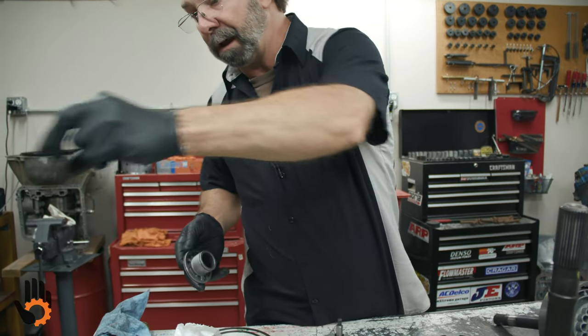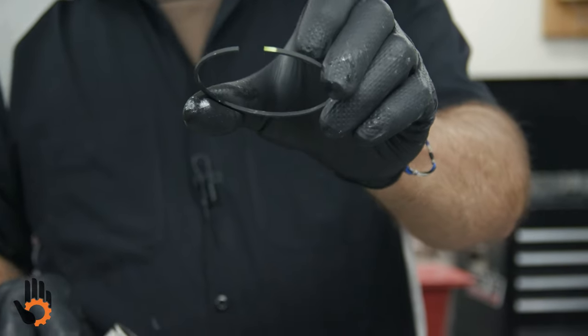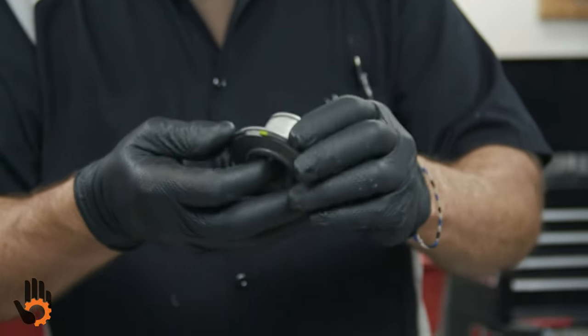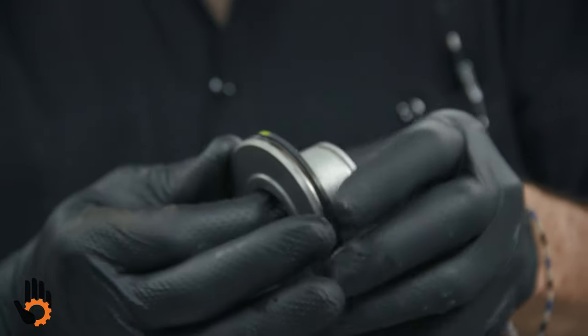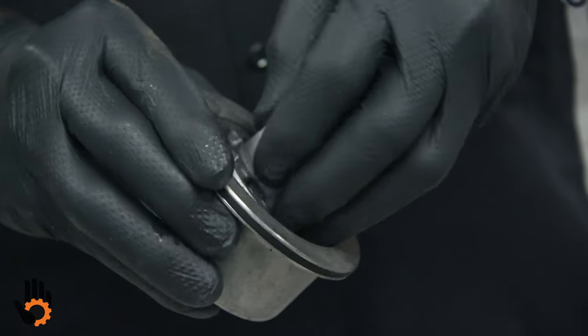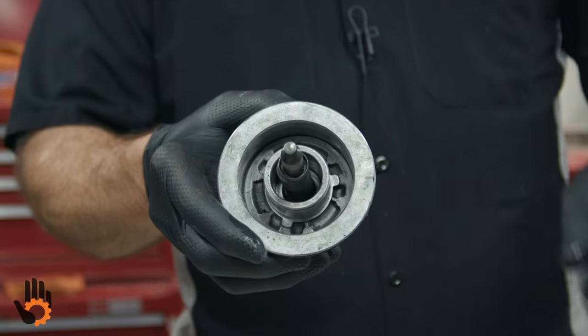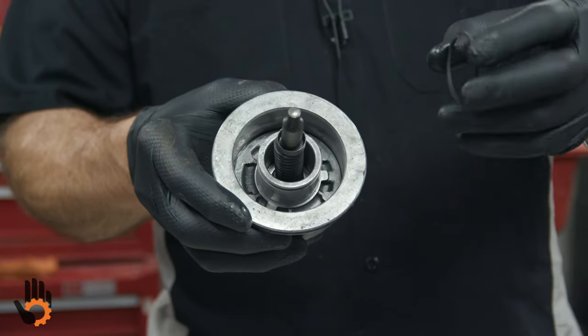So those go away. We've got a metal ring goes on the outside diameter of the piston. It's a non-locking style or what we call a butt style. You simply have to put that in there, squeeze it, and install it into that piston. Okay, don't force it in there, you'll break that ring. It's a kind of a brittle piece.